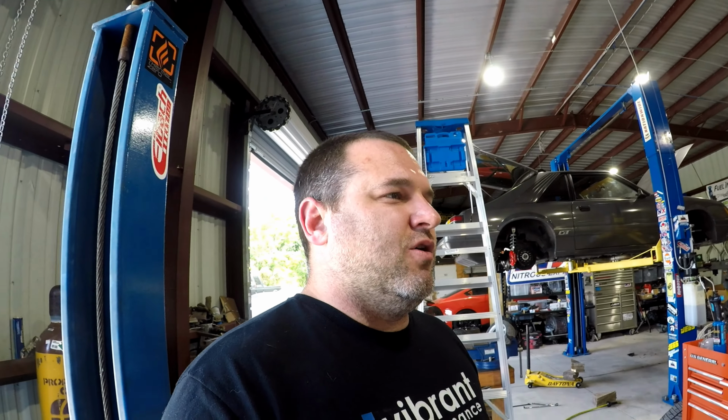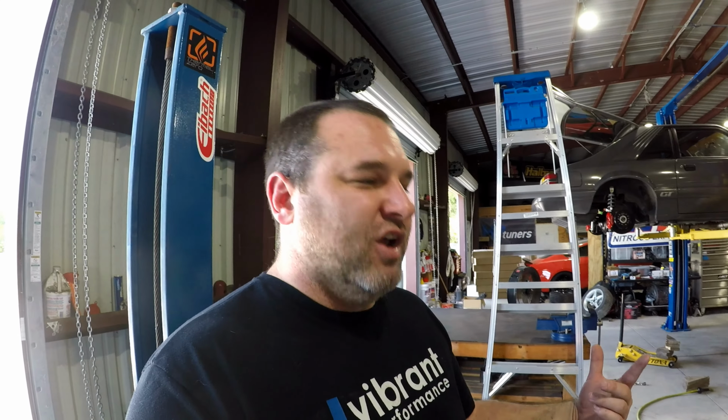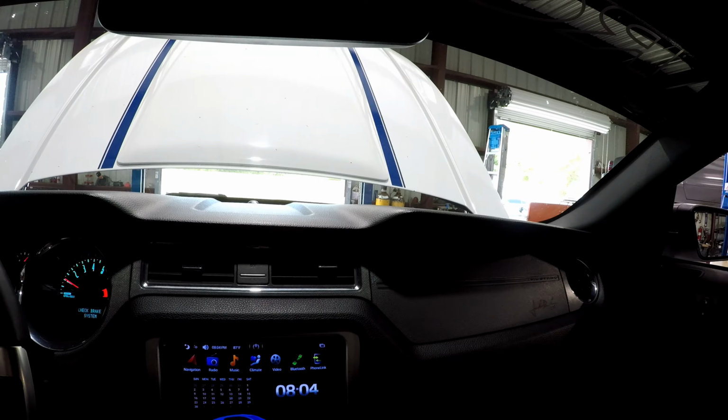Should be sitting somewhere in the range of 550, 600 horsepower. It's just his weekend car. Drives nice, it's fun. It's got 373 gears, so it's pretty dumb fast. I think he's gonna go and change the exhaust on it, but I'm gonna install this boost controller, and let's crank her up to 10, 11 PSI, see if we can make 650. All right, guys, we just upped the boost a little bit, so let's do a run.